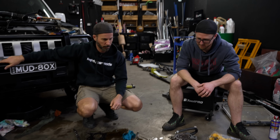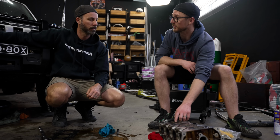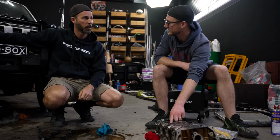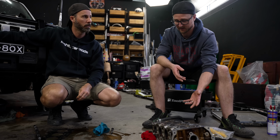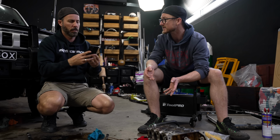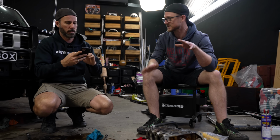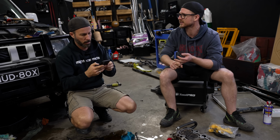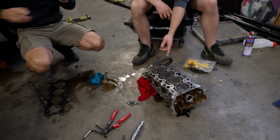It's either maybe the thing had been through some water and maybe it hydrolocked before and this was its pressure release when it happened. Maybe this went through a flood. Yeah. Maybe more simply than that, it was a really bad engine, hadn't been looked after, yes, but maybe the wreckers pulled it out and actually stored it outside for a period. Yeah. Valves don't stay closed just because your engine is off. Yeah. There's certain cylinders with valves open, so we're talking moisture ingress, heat, condensation, things that would just happen over time, and this could have sat there for 3 years. Isn't this a 15-year-old engine?